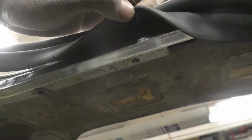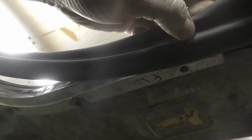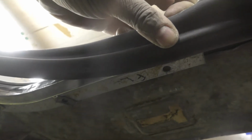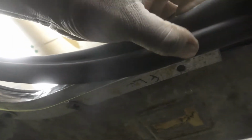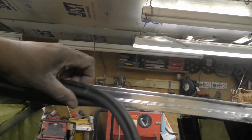Okay. All right. So I'm not gonna install this yet, but see the groove there? It goes off into that groove there. And to know which seals you got, the under part of this is gonna wrap around up under there to hide that chrome piece up under that T-top seal, guys. So for the second generation, this flap, I think some of them might come and stop right here and don't lap all the way around. But if your T-top seal that's on your car loops around up under the bottom of this trim piece, then more than likely you got the second generation T-top seals.